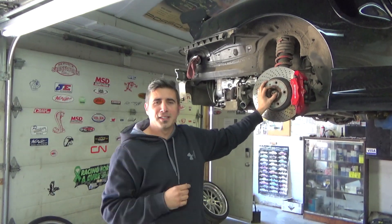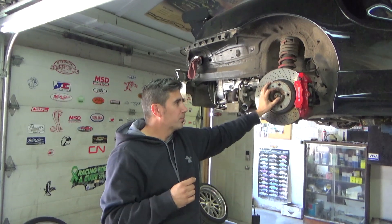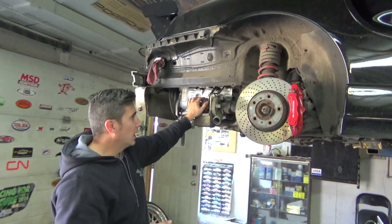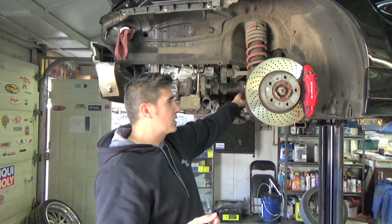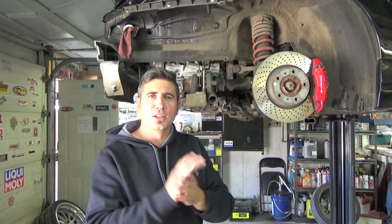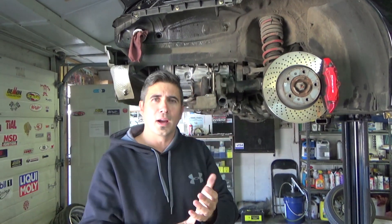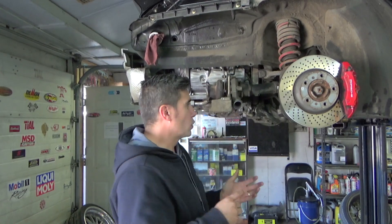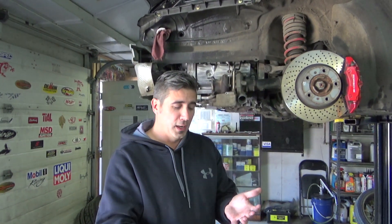Stick around and we'll see what Ed has planned next. Down the road, the next stage would be upgrading these turbos which are quite small, upgrading the intercooler piping which is already too skinny, and of course upgrading the injectors. When you upgrade the turbos you flow more air, and because of that you need to support the fueling — you don't want to detonate. That's the last thing you want; you'll be looking at an expensive engine rebuild if you don't do all the right steps. So big turbos, upgraded intercooler piping, and injectors are what we may do down the road.